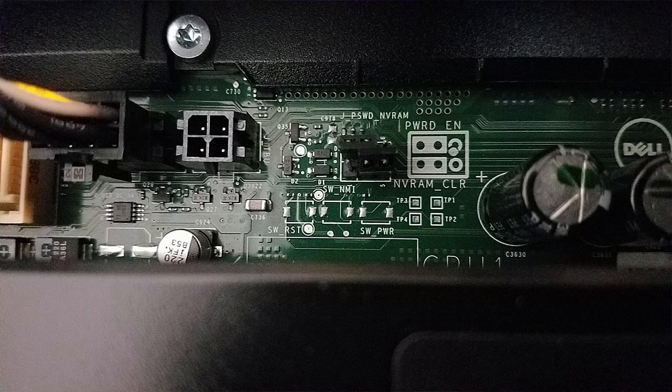So how did I get these up and running with the Dell BIOS? It was a lot of troubleshooting, and we're actually doing a write-up because there isn't really any information on how to do it on the web. The official Google repurpose page says to call them and you need a valid DRAC license. We have a valid Dell Express DRAC license, but not the full license that would allow Google to remote into the BIOS. So we could either spend $500 per server for those licenses, or find another way. Near the BIOS password reset pins, there's actually another set of pins for NVRAM. While USB boot, PXE boot, and all other boot options other than the hard drive are grayed out on these servers, if you flash the NVRAM, it unlocks PXE boot as a default boot option that triggers once it sees nothing on the drives.